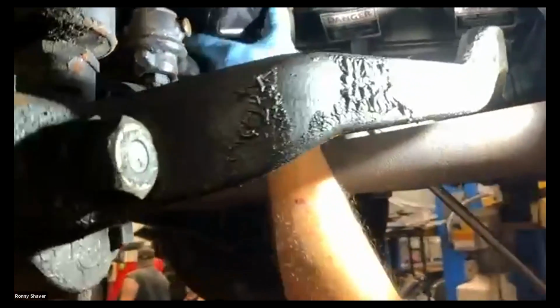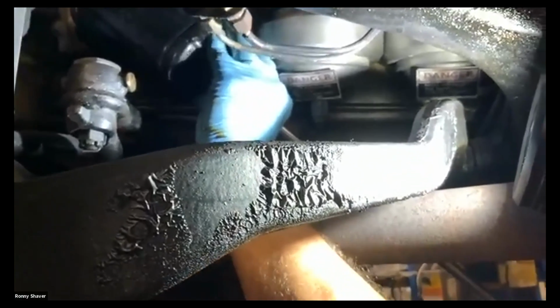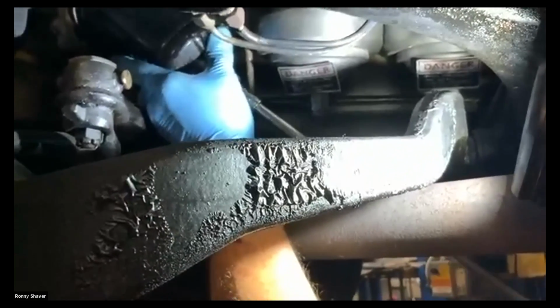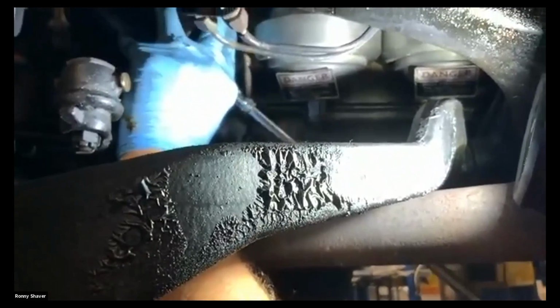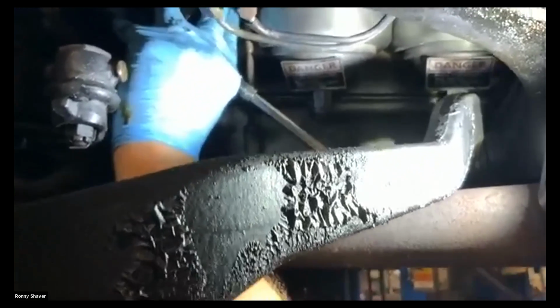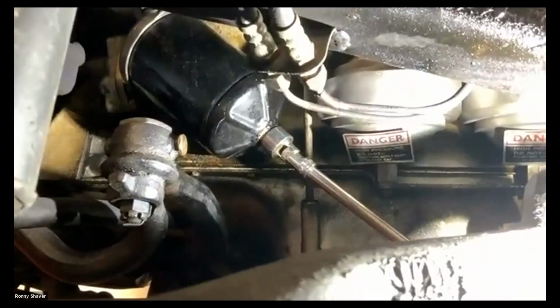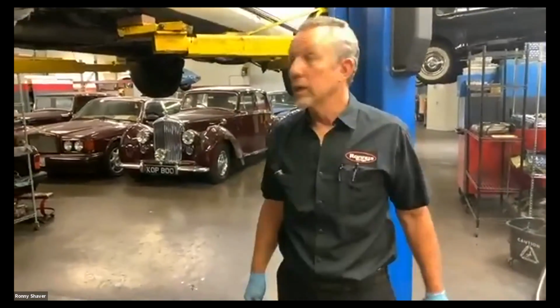So what we're going to do is see how this thing floats around. You don't want it to go up there and go cockeyed, because you start the car up with oil and it's going to just pour out of there. You want to make sure that as you're going up, you go inside that channel that has the rubber seal. See that? So I usually push it up the last bit, and then I tighten it. Now, I don't have a torque spec for that. It's a feel, but you will feel the rubber compress. If you leave it loose, this was very loose, by the way, and they were lucky it wasn't leaking. If you overtighten it, that rubber is going to fold around and it's going to leak all over the place.